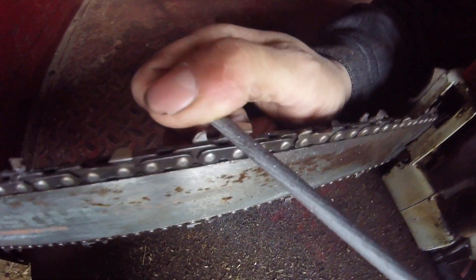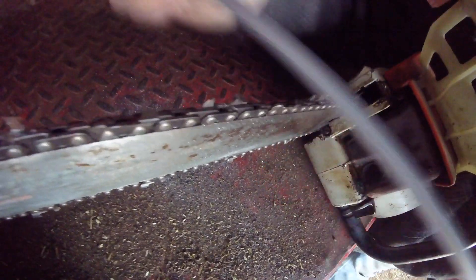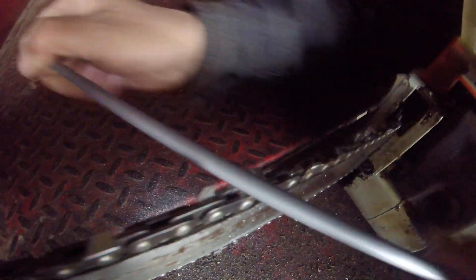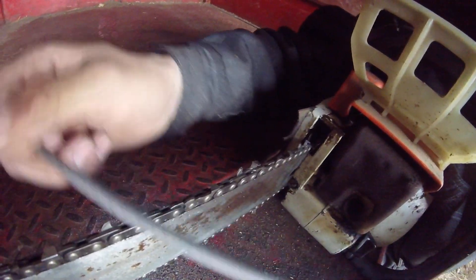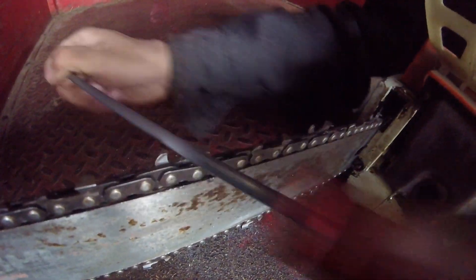Do it again here. Gullet's out — rip the top plate. You'll know if you're doing it right because you'll feel it. It'll just glide right across nice and smooth. You'll feel it removing material the whole time. Then the gullet's out again.